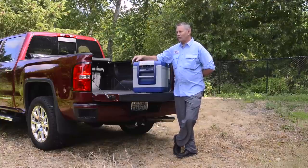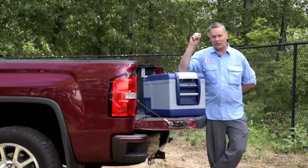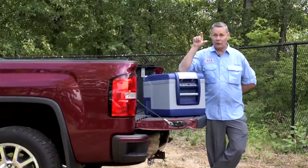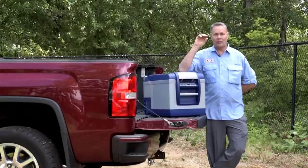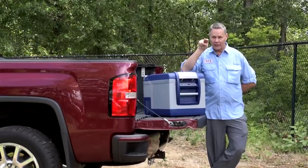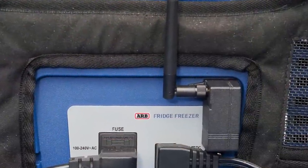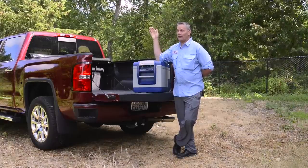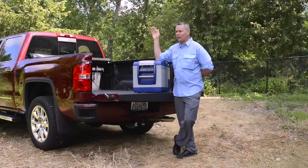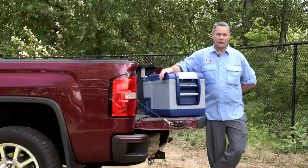The modern refrigerators you buy these days will have a small rectangular rubber grommet on the back side and there will be two pre-prepared holes in the fridge body. The transmitter unit plugs right into the brain of the fridge and reads the temperature and voltage in real time, then wirelessly transmits that to the cab or wherever you have the head unit. It goes about 50 feet through trailers and a hundred feet line of sight. Very versatile.